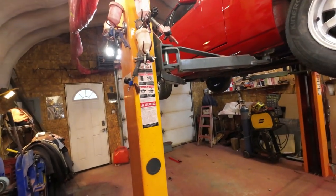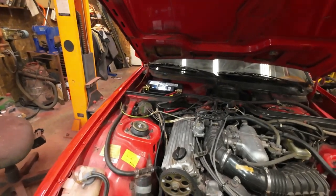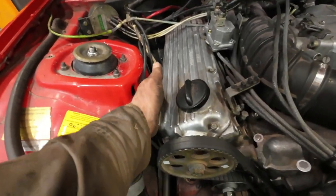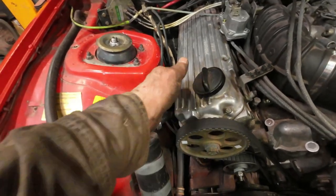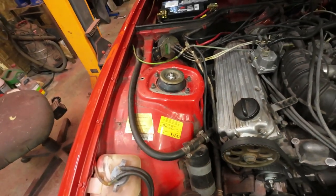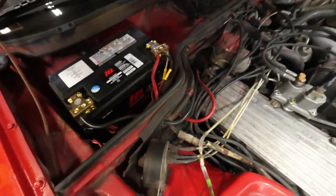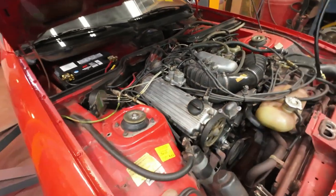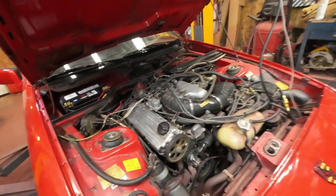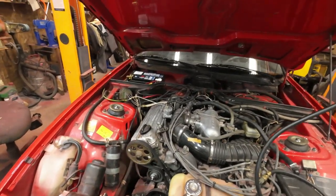I think that's it for today. I'll let it down and see how level the motor looks. Now that makes a big difference — you can get your hand down in here now. It used to be right up rubbing against that and pushing against there — it was a half inch out, likely holding it up. That's much, much better. Having the motor mounts in properly — it looks decent now and makes a big difference.